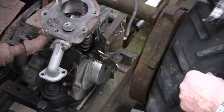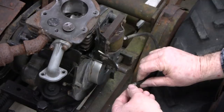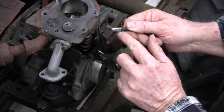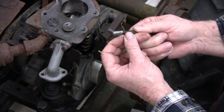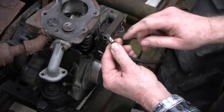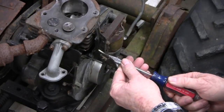Also, Mike was telling me he thought the spark plug end might have been a little loose. He says it was getting bad readings on this. Here you go. I don't know if you can see this. I guess I was okay up here. Actually, the only thing that holds these in is you squeeze them together, and there's a little pin that goes and touches the wire. So what I did is I took it apart and cut off the end and squeezed it back in there, but I also soldered it on the bottom, so there's no chance of getting no contact, and that should be okay.